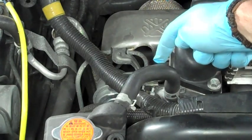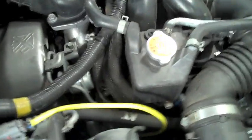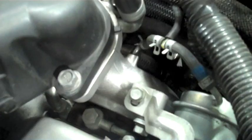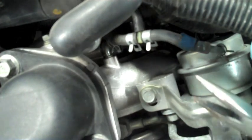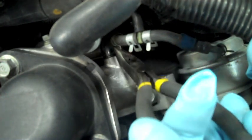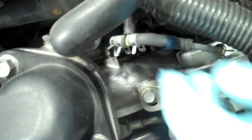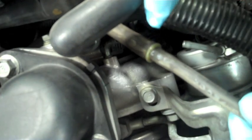Once that's done, we're going to look in front of the turbo, back to the left of the top mount intercooler. Over here is where we're going to find the OEM T between the compressor housing nipple and the wastegate nipple. To pull this off, we're going to use our pliers and undo the clips holding the vacuum lines onto the nipples. Be careful not to pinch the nipples. Use the flat head screwdriver to push the vacuum lines off the nipples — please try not to gouge or scratch the nipples. Once the assembly is apart, just yank it out. Don't throw away the whole thing as we're going to need the connector.